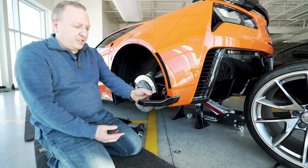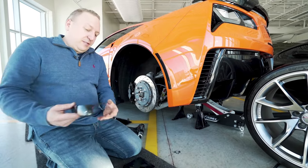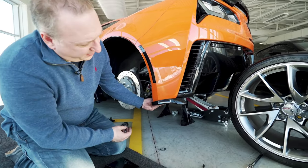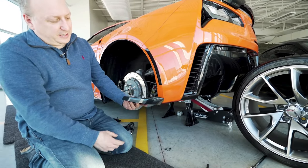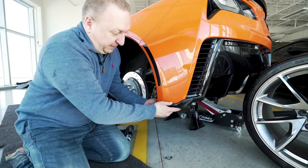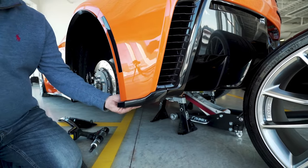I'm going to start by reinstalling the rear fascia extension. This one here is at the driver's side. We do get many calls and pictures basically saying why it doesn't fit. It is always a matter of orientation. The painted surface points to the sky and it follows a little bit the theme of the rocker. The fit should contour the fascia and the extension of the diffuser.